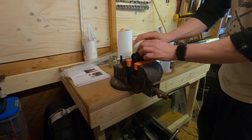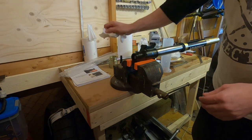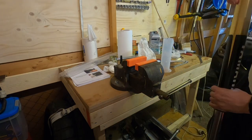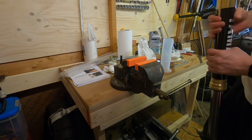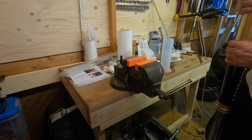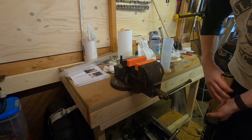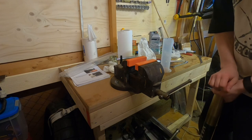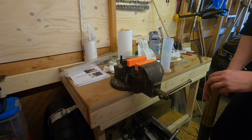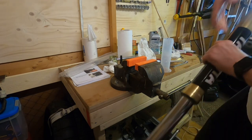The leg is done — everything should be hunky dory. Install it back on your bike, clamp it in the bottom clamp, then tighten the top cap a bit more. Go for a little test ride, let it settle in, then check your sag and adjust. You might need to put in more spacers — adjust to your liking. That's it folks.